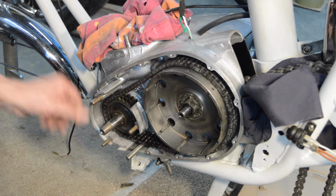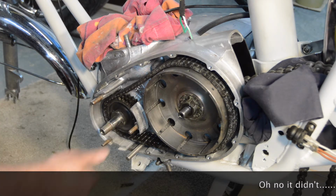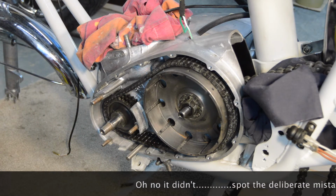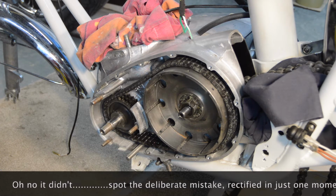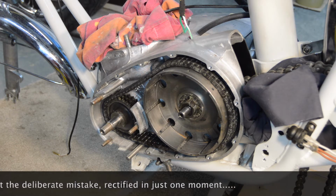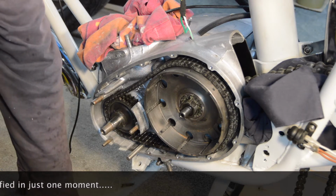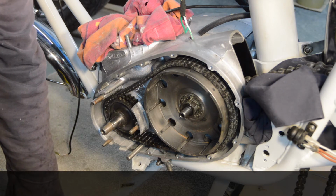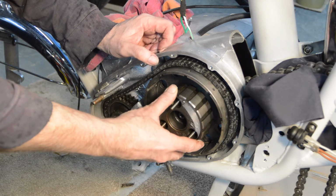Lovely. Right, so from there, did that go there? Yes, it did. From there, we have to build up the clutch. The alternator parts are not with me yet, but I can build a clutch up, which I'll go and find the parts for now. Right, the clutch centre's got to go on, which is here with its 3 bolts. So that fits on its little locating splines.